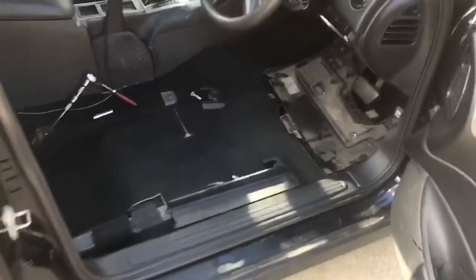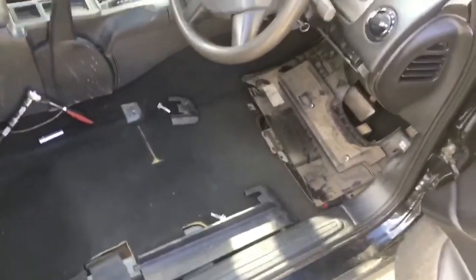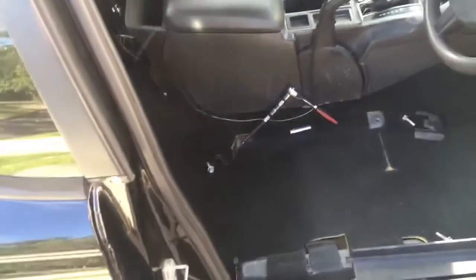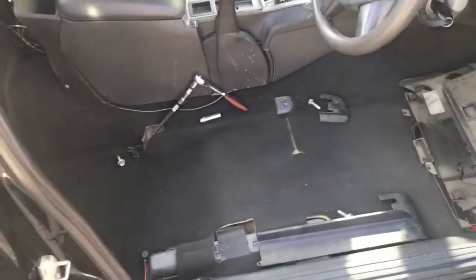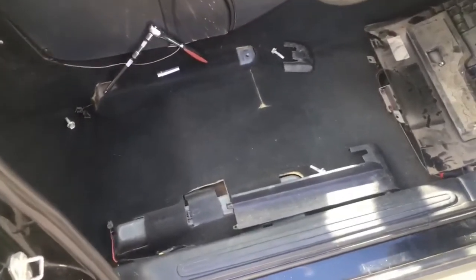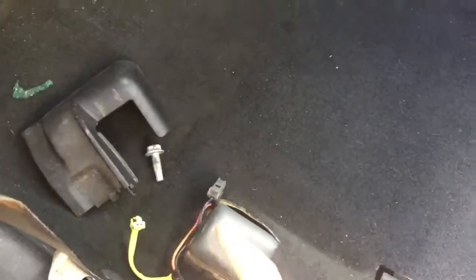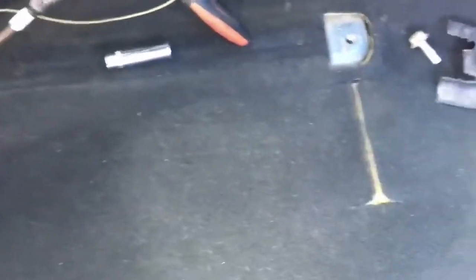I have already started but I've laid it all out so I can show you what I've done. First thing you want to do is get rid of the seat. It'd be so hard to get in there with that seat in there, especially in this little cab. It's four bolts and a few plastic covers. These plastic covers just slide forward, uncovers the bolt, take it out. Unplug it, seat comes out. Life's a lot easier - plenty of room to get in there.